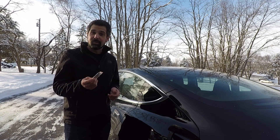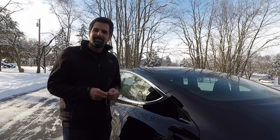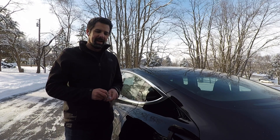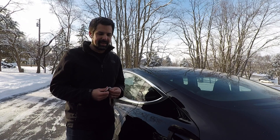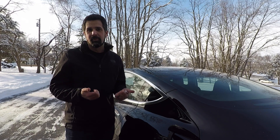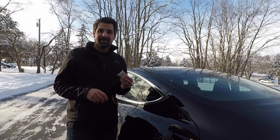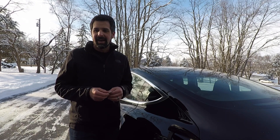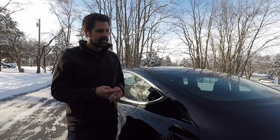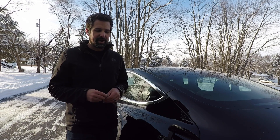All you need to do is have these with you — I would recommend going out and buying a 2-pack right now and keeping it in your car. Then have about 5 to 8 minutes to spare to shove this in there after you activate it. Make sure you shake it around and then put it in the charge port. I gave it 8 minutes and it seemed to thaw it out nicely — the car is charging perfectly right now. Definitely a viable option. I've also used hot water in another one of my videos. To all of you that have suggested hand warmers but never tried it: great call. Those are a couple of cold weather tips — your frozen door handle technique and a way to quickly thaw a frozen charge port latch.